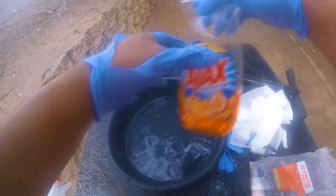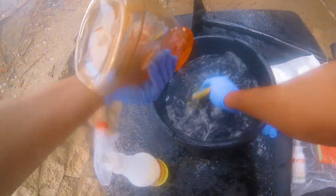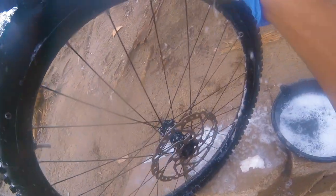Now I know you were gonna ask me about the dish liquid soap — what is that for? We're gonna apply it on the lip, scrub it in throughout the lip, so when we charge in the CO2 it'll be easy for the tire to slide in and sit on the lip, because it's all bubbly.